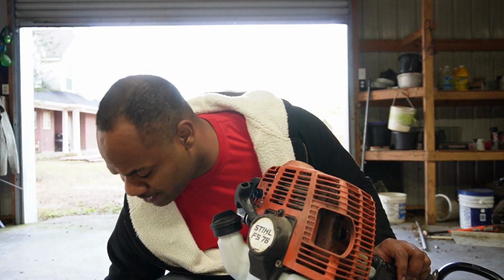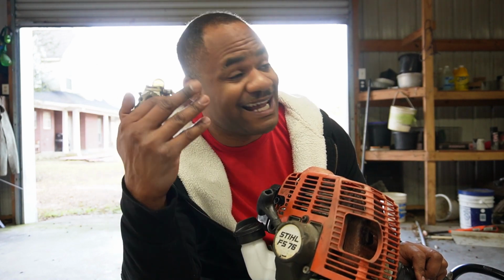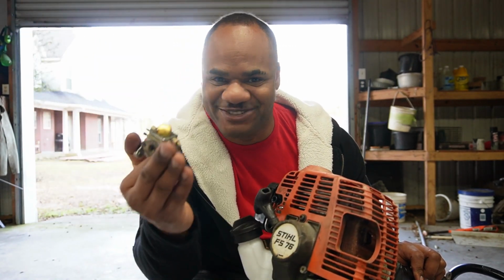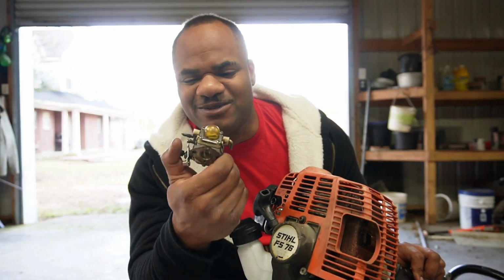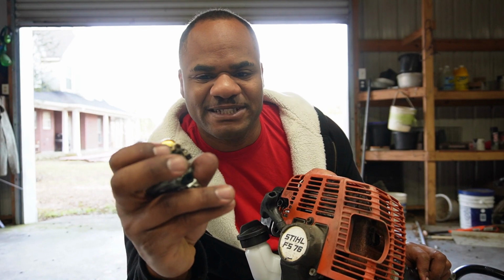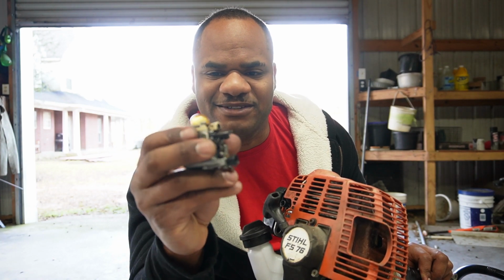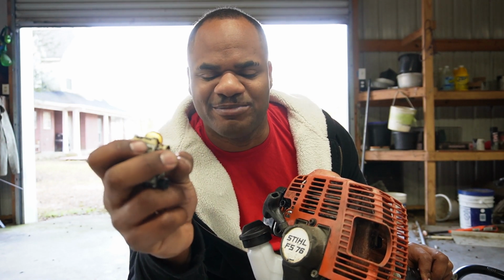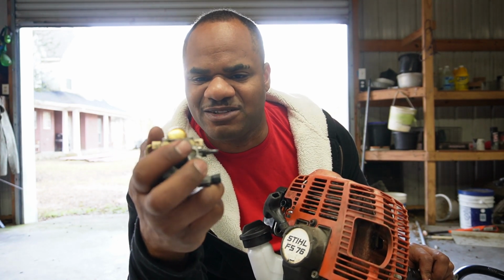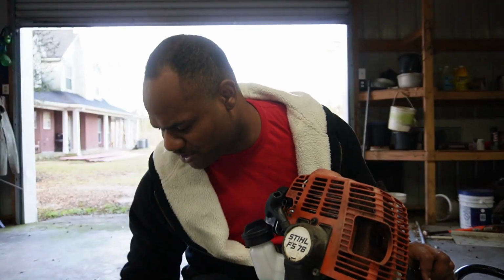New carburetor on it. Old carburetor, nothing wrong with this carburetor. You seen the last video, go watch it, the card or in the description below. This one fired up pretty good, so there's nothing really wrong with the carburetor. It's just missing a high. I think that's the high and that's the low. It's missing a little knob on it to make it idle and do what it's supposed to do. But it's no biggie. I just turn it with my fingers or some pliers. So this is a good carburetor. It just needs to be cleaned. So I'm going to go ahead and keep that.